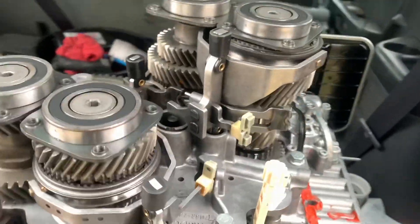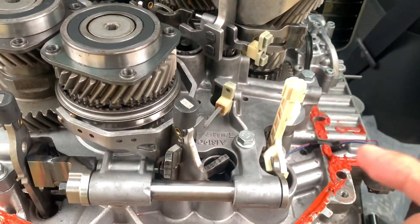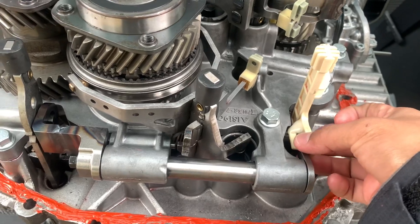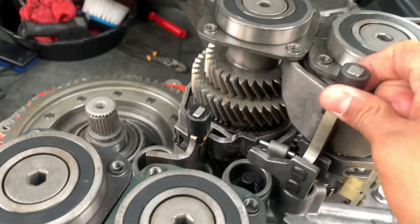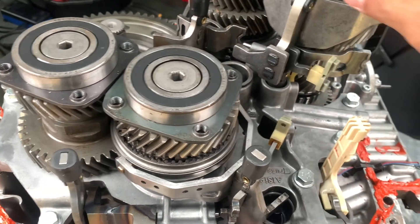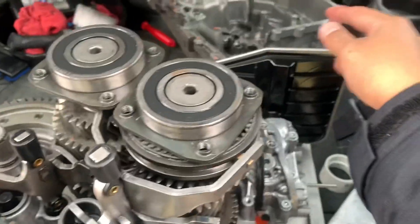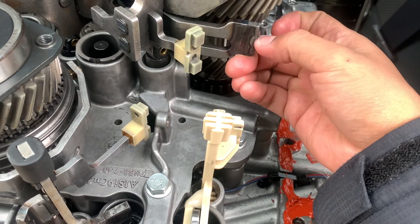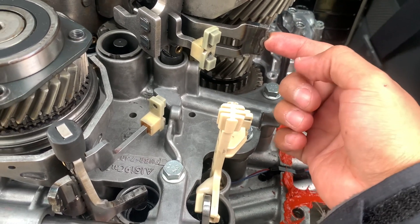In this video I'm going to demonstrate what's going to happen when you're putting the other case on top of this part of the transmission. All these shift forks have to be pushed up — this one straight up, this one straight up, this one and this one straight up. When you're putting them down they're going to shift back up. Your only window when putting that part on is viewing it from here, so you can push this up, align it, see that little ball bolt, and just torque it down so they won't shift anywhere.